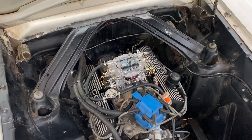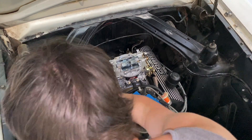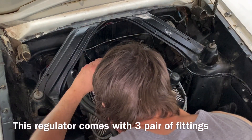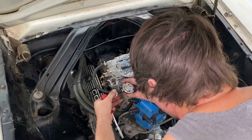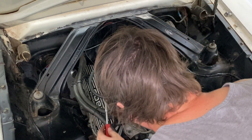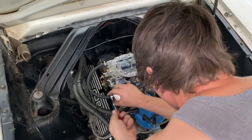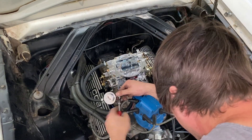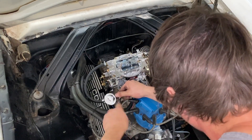It would appear I'm leaking from my brand new regulator. I swapped on the fittings that almost appear to be too large. I think the problem is there's not enough distance to get the crimp. That was a lot of fuel — I was leaking more fuel than I was before I started. That's never the move. It did kind of sound, for the brief moment that it ran, almost better — like smoother.